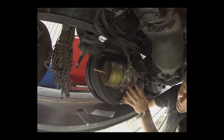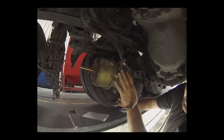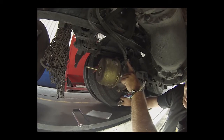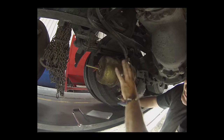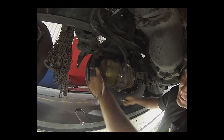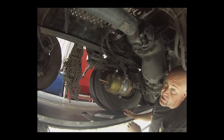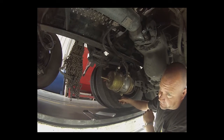If we're caging this brake because there's an air leak, the air is always going to come from the hose that is closest to where you just put the tool in to cage the brake — it'll be this hose right here. On a trailer this could be flipped around, but it's always going to be the hose closest to the tool. All you need is a pair of vice grips — pinch the hose off just like that. That should stop the air leak. The brake should be released so we can get it to a repair facility.